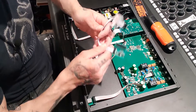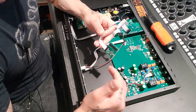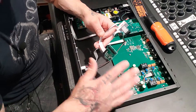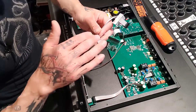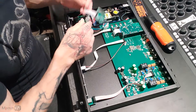What was happening was that on some setups, the power could fluctuate too much. If the power the 80 Plus was getting dropped too low for a split second during the boot-up sequence, it could cause the 80 Plus to get hung up and the internal computer to freeze. That's why power cycling the unit would solve the issue. The new mod just automatically restarts the boot-up sequence if it detects that it was interrupted. So pretty smart, super easy to install.